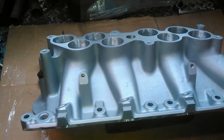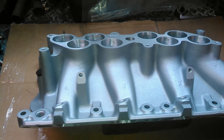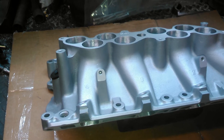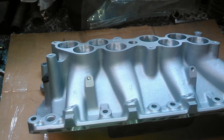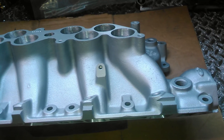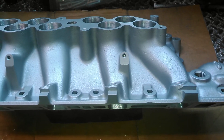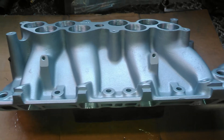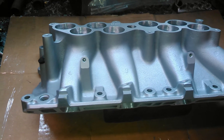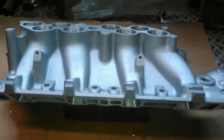This is the lower right here. The upper received a full cut and welded and runner-shortened port job. We shortened the runners for his application. He's running a one-inch spacer to clear some tall valve covers, so we had to shorten the upper an extra one inch on top of the length that we shortened for the upper RPM and displacement for his motor.